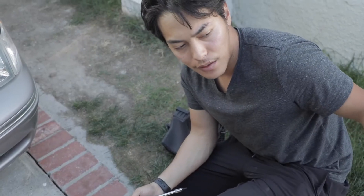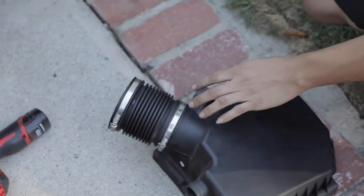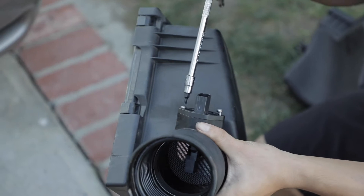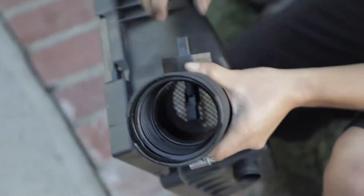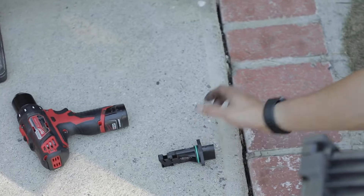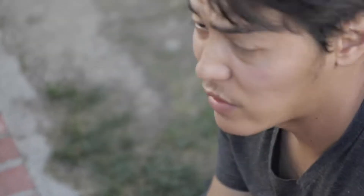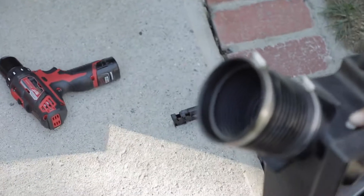Once you've got the heat shield and the filter for the air pump hose on, the next thing you'll need to do is remove the stock intake boot and the mass airflow sensor out of the original housings. These are T15 screws — just unscrew them and they come right out. Do be careful: the MAF sensors have an O-ring on them, so make sure you pull them out straight without damaging the green O-ring, otherwise you'll have to get them replaced. Evolve does not give you any replacement O-rings for the MAF, so just make sure not to damage yours — pull them straight out and be patient.